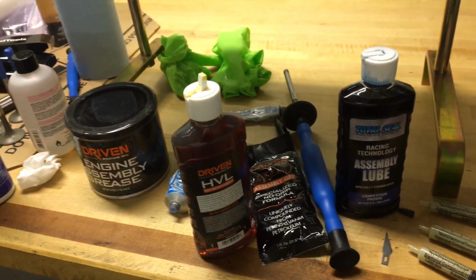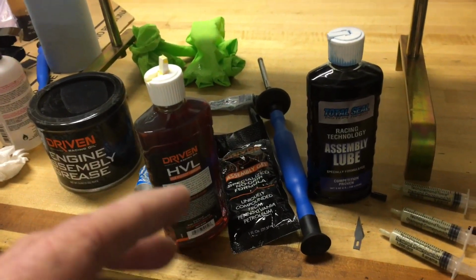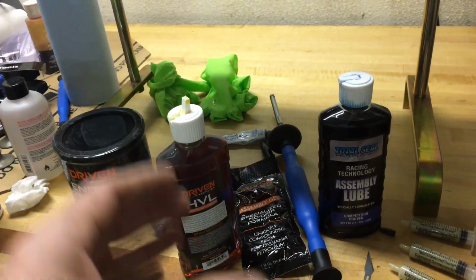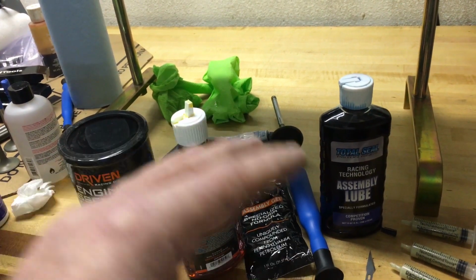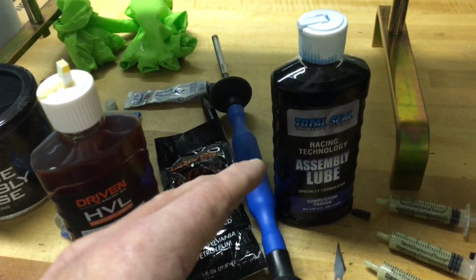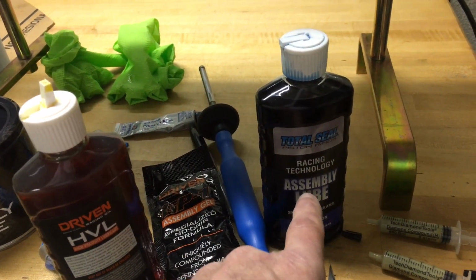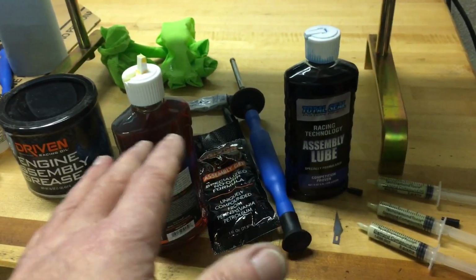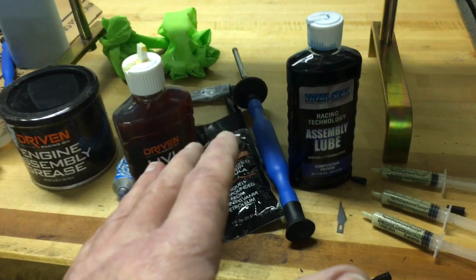And then, as I may have mentioned, I used a product called Quick Seat, which is a dry film lubricant, in the actual cylinder bores in the crosshatch pattern to help the rings seat in the cylinder bores. And on the skirts of the pistons, I use this. Now, no other oil on the bores, only the dry film Quick Seat lubricant.